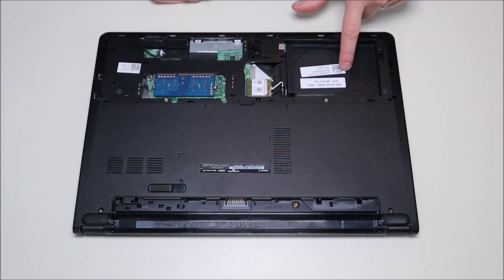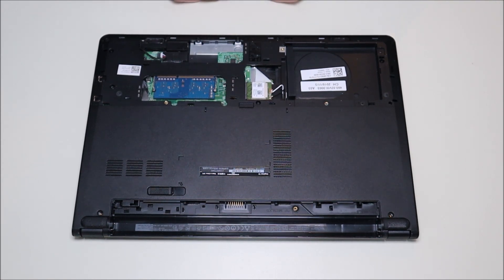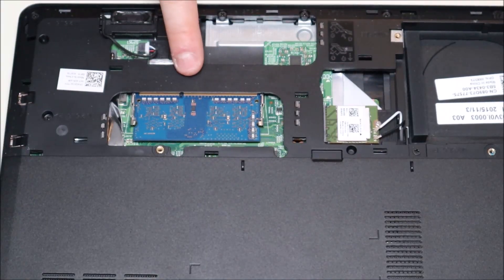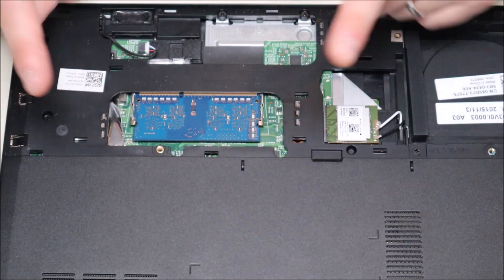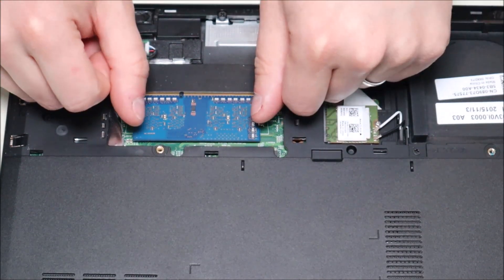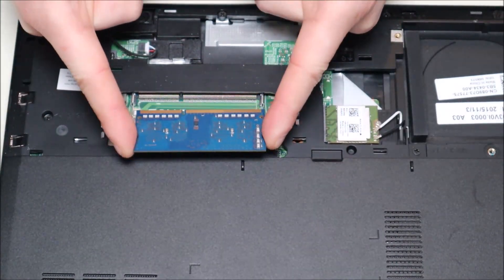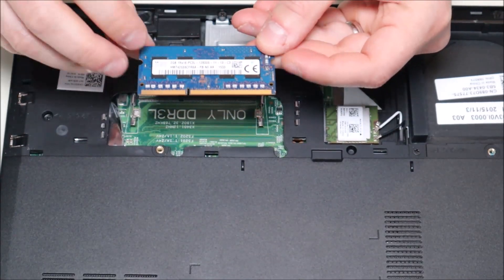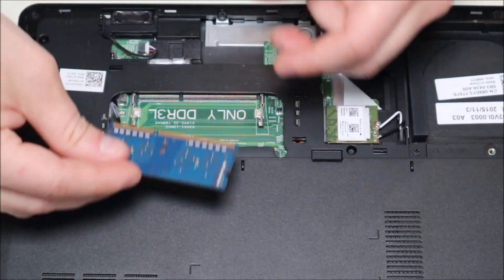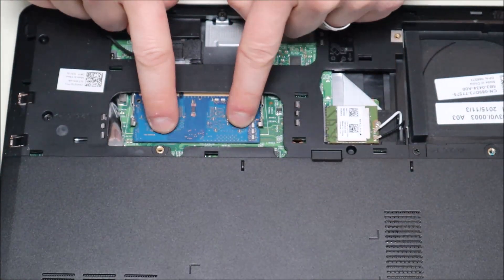Here you have a hard drive space where you can put in an additional hard drive, your Wi-Fi card, and your RAM card. I'll zoom in a little more to show you how to take these out. Laptop RAM — this is very common how it looks. It's held in by two metal spring-loaded arms. All you've got to do is pry apart these arms and the RAM should just pop up, and then you slide it out. It's a long port, short port, so it's got to go in the correct orientation. To put it back in, simply put it in the port and snap it down.